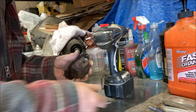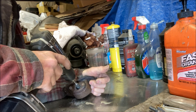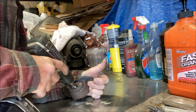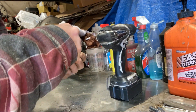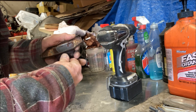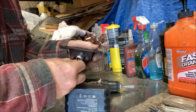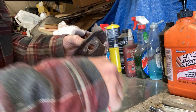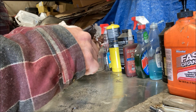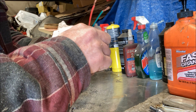The unibit got me most of the way. I'm going to clean it up with this carbide bit to get the last bit of that socket out, then just keep filing it until the new socket fits in nice. It fits in there good and tight. I'm going to grind this down to bare metal, put the socket back in at a height where I can still get the bulb in, and put a couple of tack welds on the bottom to make sure I have a good ground to the housing.